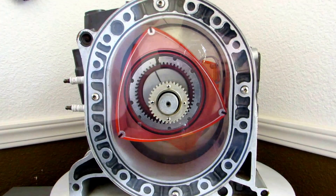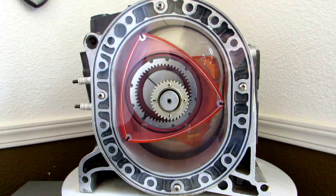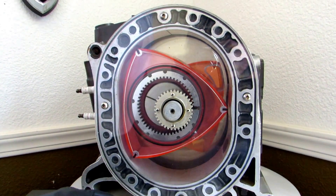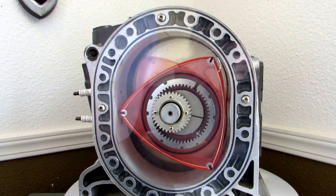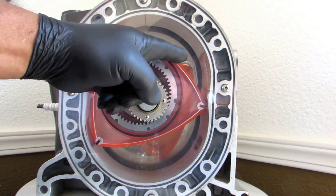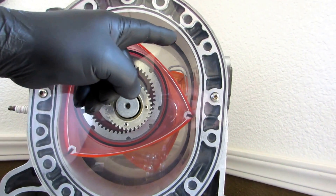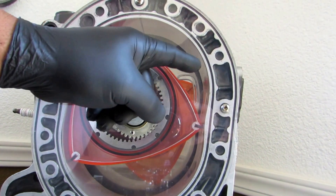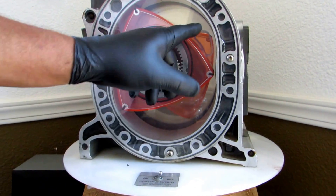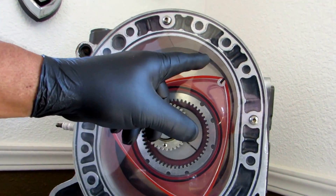This is a typical Mazda Rotary full-size model made by Mazda — a 12A configuration, 1200cc. What happens here: the gas comes in through the intake port. There would be another one on this side, but Mazda didn't put one in because kids would put their fingers in there. It pulls gas all the way until the rotor shuts off the port.